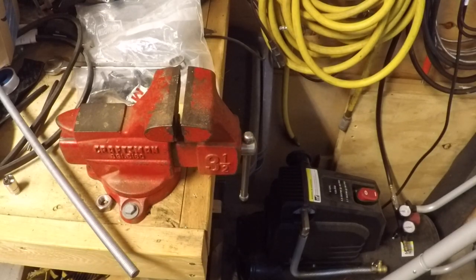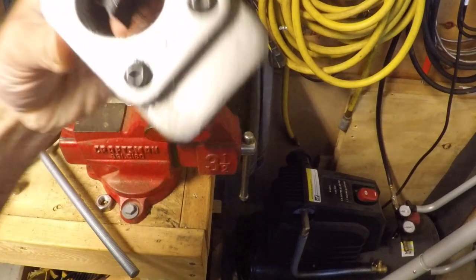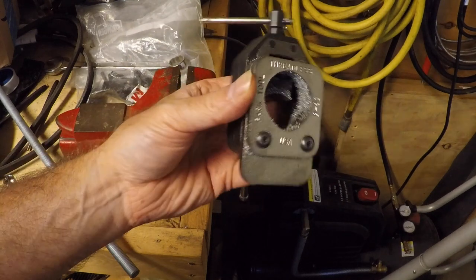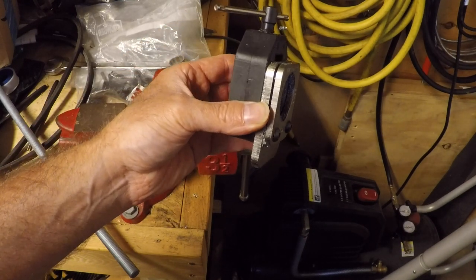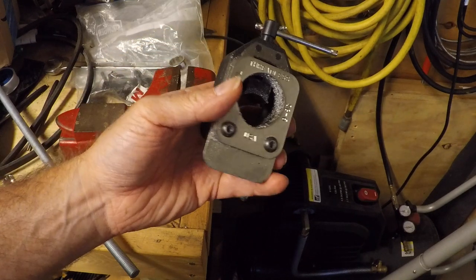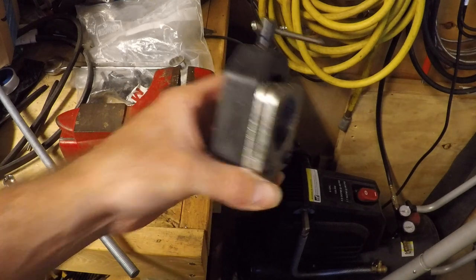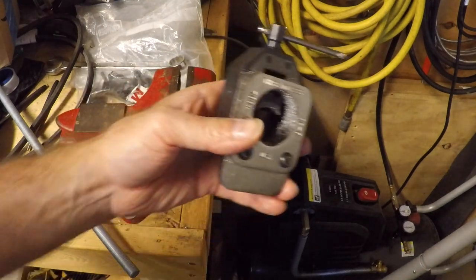Okay, we're in the garage and we're going to cut the fork. To do that, we're going to use two tools. This is a Park — I think it's an SG-6 — it's used to cut forks, steer tubes, handlebars. There are some tools I think you should definitely have, and this is one of them. Let me tell you why: you use this to cut your fork, your seat tubes, and most commonly your handlebars. You can take a hacksaw and just hack away, but I just wouldn't. This is a great tool and I use it often. Anytime I'm making fine tuning adjustments, it's something I wouldn't think would be bad to have in your toolbox.